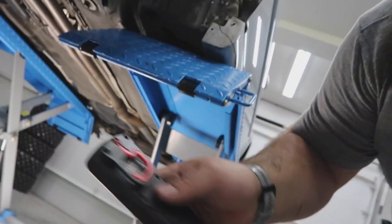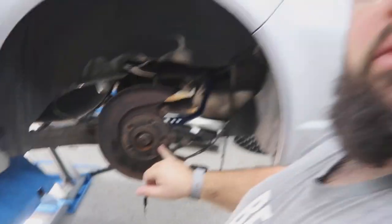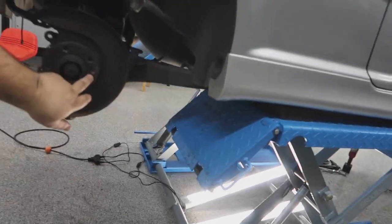I think I ran into a bit of luck here — I'm going to ride that luck train as long as it lasts. The front sway bar: I did exactly what everyone said and it worked out, so that fits. Put the subframe all back in, hand tightened. Those are one-time-use bolts so I have more coming, but they all tightened. The cool thing is whoever stripped that nut before actually updated the bolt — it's longer. So I'm just going to buy a nut and thread it onto the end of that bolt and life's easy. Now I'm going to replace those hub caps, because when I took off the rotors one was rusted in there and I've stripped that hole.